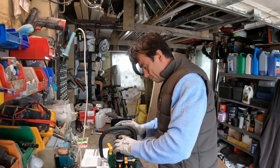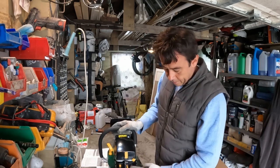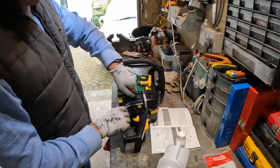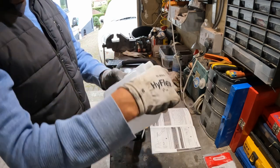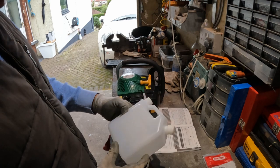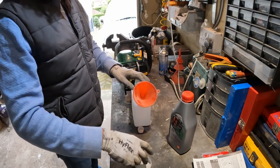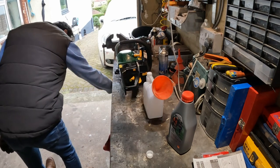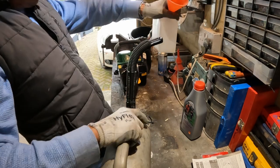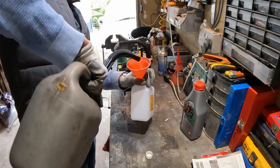The next thing to do — here's your little primer — is get some fuel in it. It's a 25 to 1 ratio. Here's the petrol cap. You've got to mix this with a 25 to 1 ratio: you put the oil this side, petrol this side — two-stroke oil for lawn mowers and light equipment. All you do is go to one of the corresponding lines on the measure and then do the same with the oil.